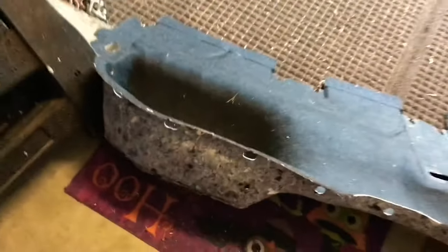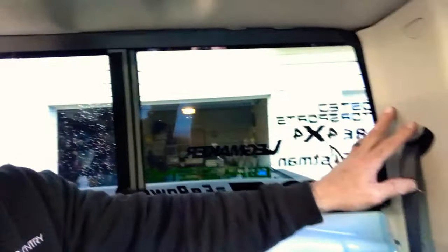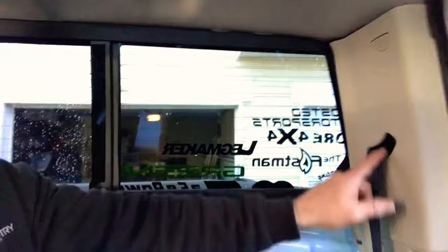No more wet boot smell. The tricky thing is if I had seen water at the corners on the headliner I would have known quicker exactly what it was. But I didn't have any water showing there at all — even when it's dry it can still be leaking. It kind of sneaks behind this panel, goes down, and spreads all over the place. Alright, let's get that third brake light in. It's a pain because it's a two-year-old truck — you wouldn't expect something like this. But I've got to stop the leak — I'm not gonna drive around in a Laramie with full leather and smell like a wet boot.